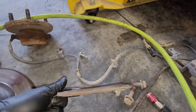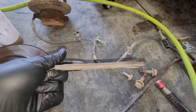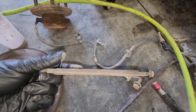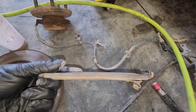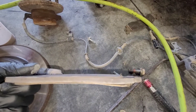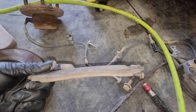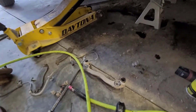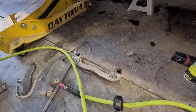The bigger issue I'm seeing here - if you'll look at this, by my thumb here, it's almost worn down to the backing plate. Yet over on the right-hand side, you can see we've got about a sixteenth inch of pad material left. What the heck is going on there? Why is it wearing at an angle? Well, that happens when your caliper slide pins get stuck.